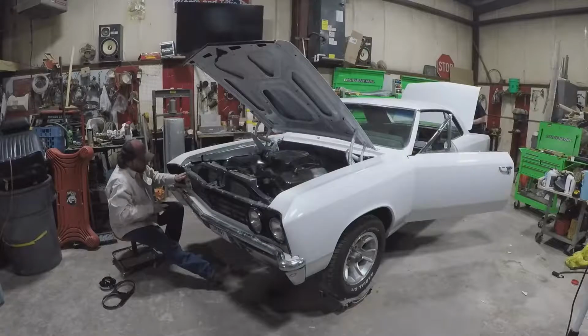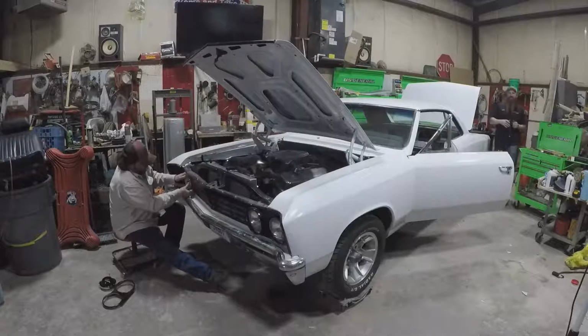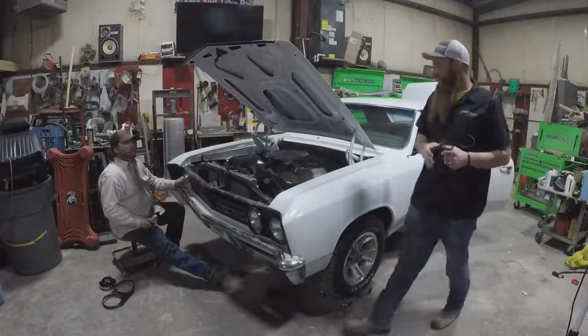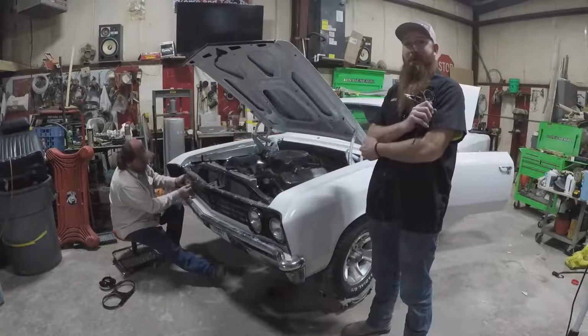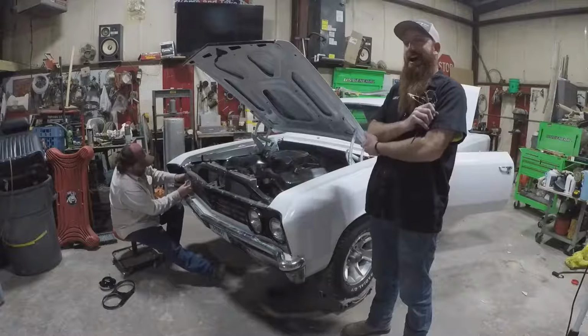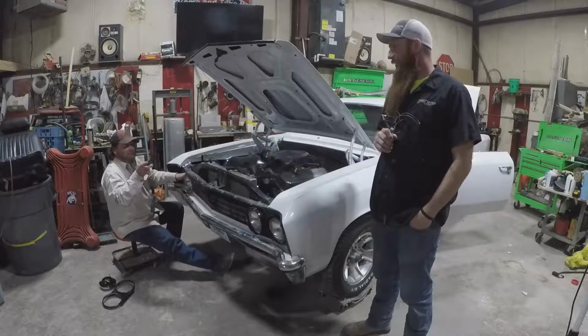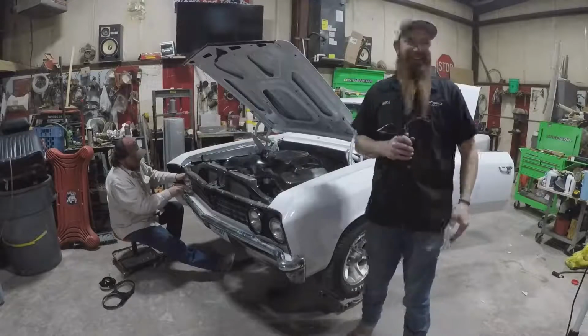Grandpa Mel says, tell them to run a wire from negative battery to ground screw on the body. Check the wipers and the tail lights then. That's a very good observation. Do you actually have a chassis ground to the battery? Sounds important. He does not. I do have one. I think it's on the bench over there, but that's not helping us on the car.